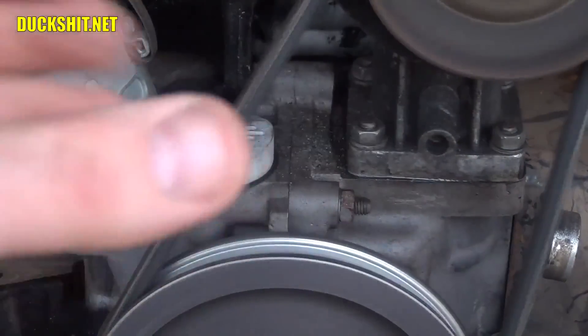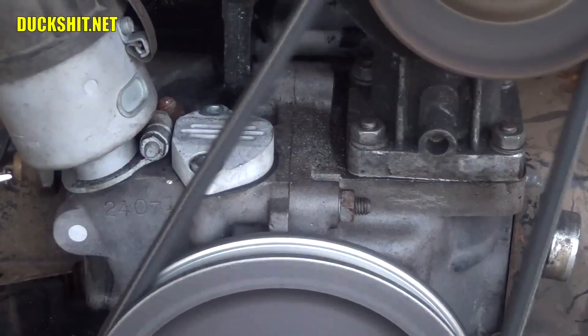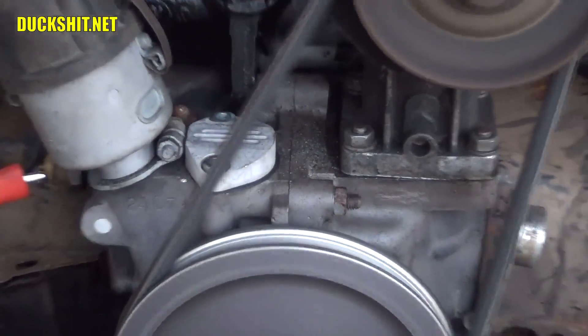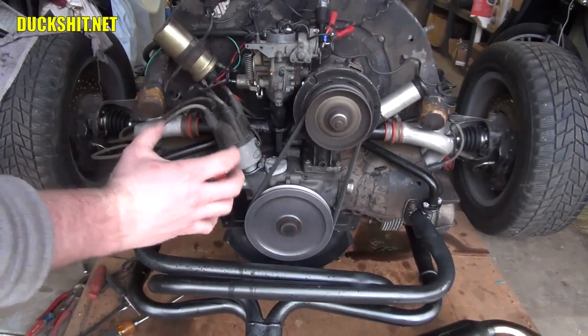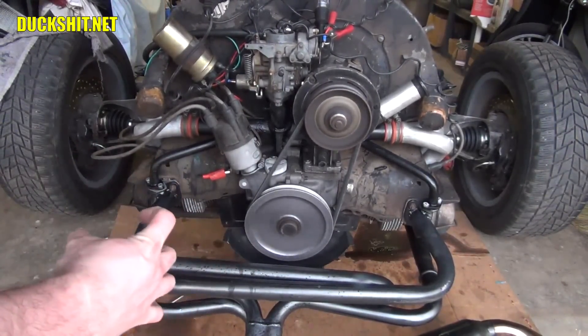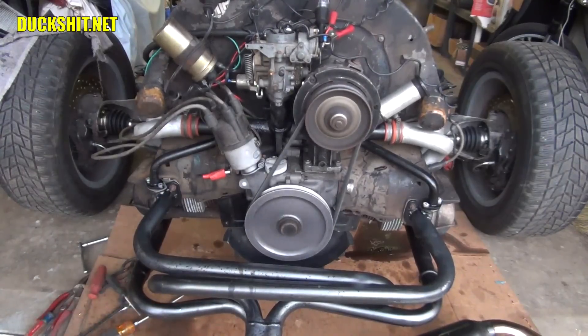I can adjust the distributor a little to bring it up to 32, but is it going to make any difference as far as revving the engine? No. What I might be looking at is a typical revving problem that 009 distributors have, which is rather typical because they don't advance by vacuum the way vacuum distributors work. When you hit the throttle, it advances the distributor - the 009 doesn't do that. They advance when they hit a certain RPM. That's a big advantage to the SVDA - single vacuum, dual advance. Let's shut it down and go have a look at the distributor I'm currently rebuilding to put on this engine.